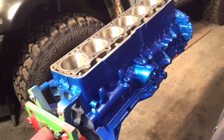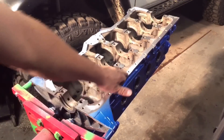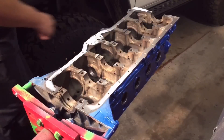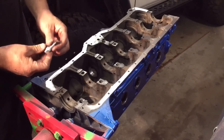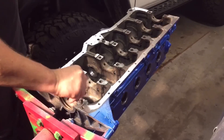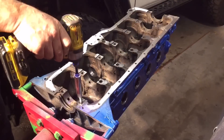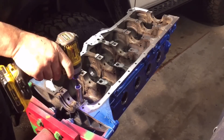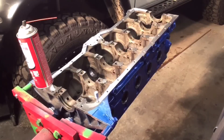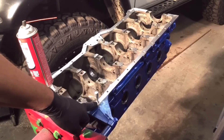Got her all painted up — real pretty blue. Now I'm going to go through and get the crankshaft area ready. I'm going to start on the bottom end, but first clean off the oil pan gasket area. I'm going to go through and clean the threads on every journal and then the holes for the oil pan. This is a 1/2-13 thread chaser — not a tap. Taps make it a lot easier to re-thread by mistake. Stick it in there, little shot of brake cleaner, run it down nice and easy and right back out, and go on to the next one. The corner ones are 5/16-18. Some of them on one side will feed all the way through; most have a pocket underneath and you'll bottom out, so just be careful.